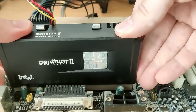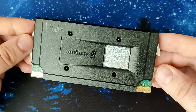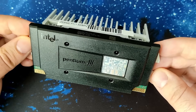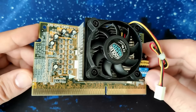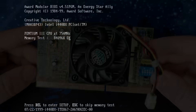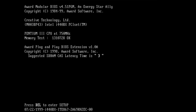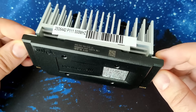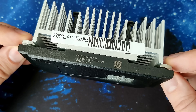In my previous video I used a Pentium 2-333 to test if the board boots. For today I selected a Pentium 3-500, because I couldn't convince the board to boot with a frontside bus of 133MHz and my Coppermine Pentium 3 at 1GHz. It did boot however when the frontside bus was set to 100MHz, resulting in a frequency of 750MHz. Since I am not planning to run performance benchmarks, I decided to use this Pentium 3-500, which requires 2V similar to the Pentium 2.